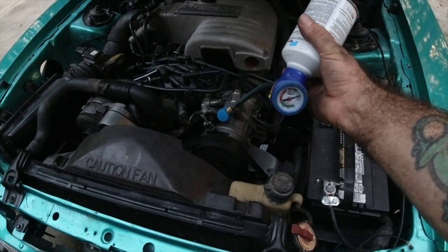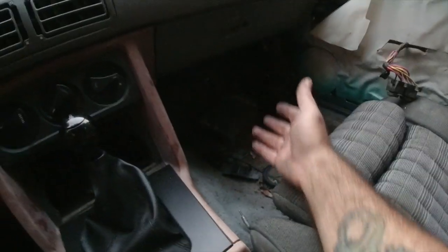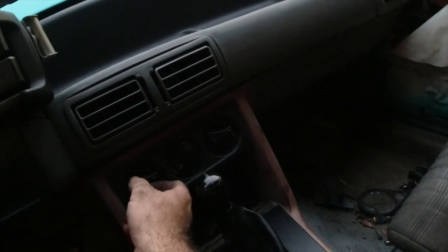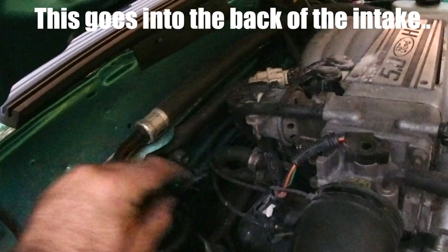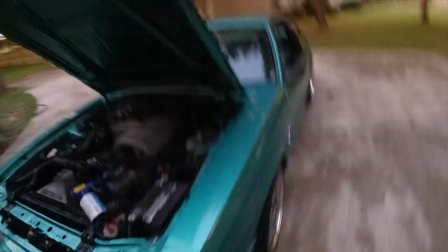I'm going to go ahead and finish filling this up and let you guys know if it's actually cooling. I'm blown away — we actually have cold AC! Originally it was only blowing out of the bottom, but there's a vacuum line under the hood and I found it unplugged. I made a quick vacuum line, tied everything in, and now look at this — everything works, it swaps around to defrost. This is the vacuum line I had to make. That noise you're hearing is just the pulley — the engine is fine. I'm telling you, this thing is coming together and I could not be any more proud. Alright guys, that's going to wrap this video up — as always, thanks for watching.